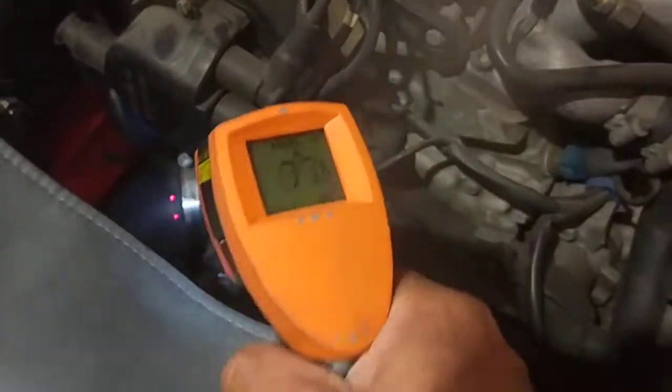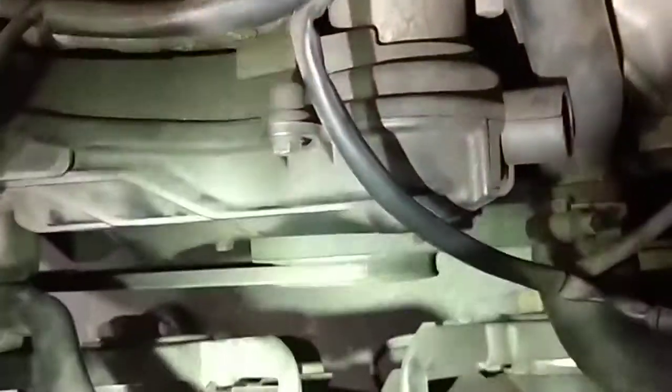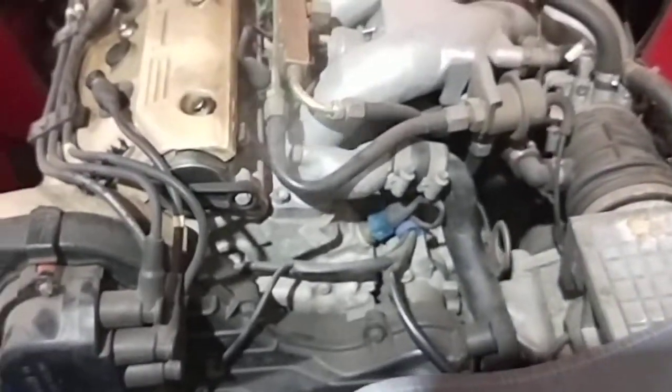If you look at that one there - that's 87 degrees. And that one there is 32 degrees. I've got to check for blockage on the line, on the radiator. And one more thing - the actual fan did not even come on, not at all, not even once. It should come on when the engine gets really hot. I've got to check the actual fan speed and we've got to check the thermal switch, the electrical circuit, the sensing circuit for the actual fan, to see what's going on. I've got to check for any blockage. Thanks for watching and please subscribe.